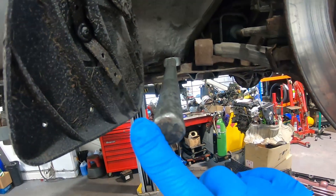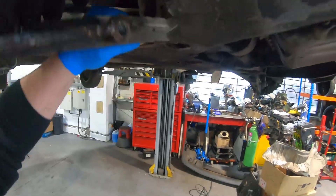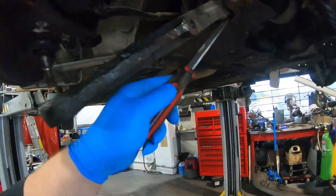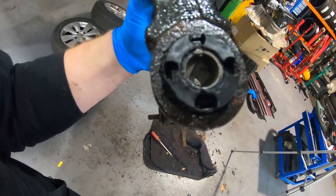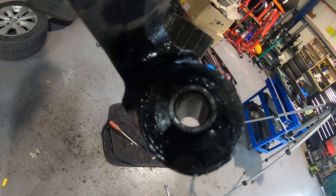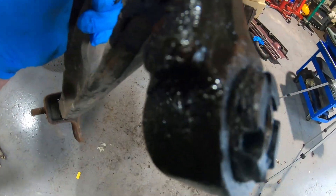Two bolts undone, a ball joint splitter tool in there, and it has cleared enough that I should be able to get the arm out. This front bush, surprisingly being the worn one, is the one holding me up. And we're off - so there's the bush. Weirdly it doesn't look too bad, but actually you can see right close up there the actual metal collar inside has come away from the rubber, and that one's pushed in a bit. So now I've just got to hope and pray that the new bush I bought is the right one.